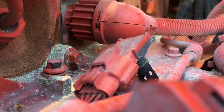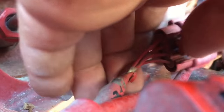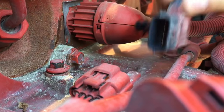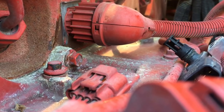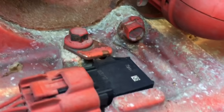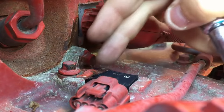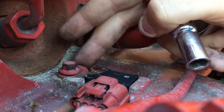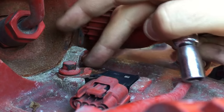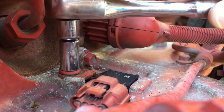Just push this little pin down — that's all there is to it. I'm going to go ahead and put the new one in and I'll pick back up in a second. Now I've got the new one in. If it doesn't look like this then it means it hasn't been changed out, so you might want to change it. It's a little tight and snug going back in because you've got a new O-ring on it, so put a little pressure and wiggle it back and forth as you push it down, then slide your little tab back over and snug it down.